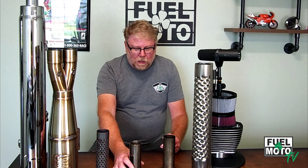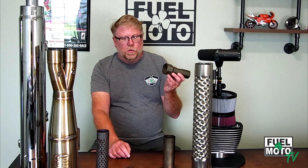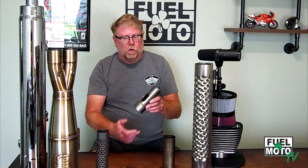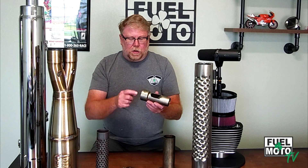You find that most inserts work best when they're in the back of the muffler. There are a couple of companies that say to put it at the front leading edge of the muffler at the collector, but we found over the years that is not a solution that really works well — not in the stuff we generally work with day to day. Most applications really like the insert in the back of the muffler. You have the volume of the muffler, but then you have that insert in the back that helps with the reversion. These work really well in anything that has a two-and-a-half-inch baffle — in the Reinhardts, the Bassani, and other stuff with a two-and-a-half-inch core, louvered or perforated.